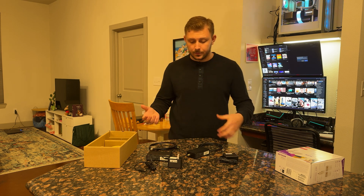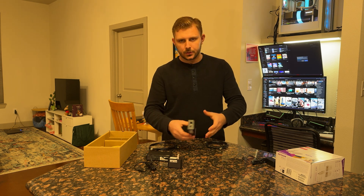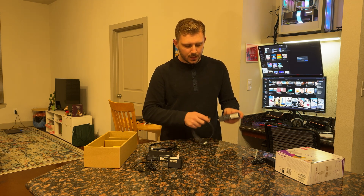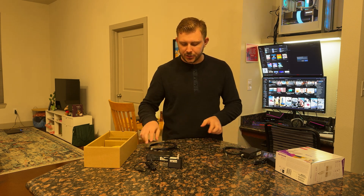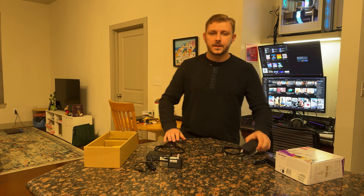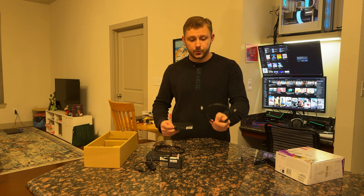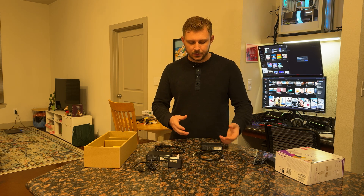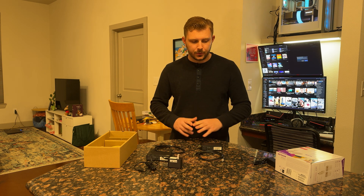To set these up: plug them into power, hook your ethernet up to your router, switch, modem, or whatever, hook your coax up here, put the other end to the wall where your coax jack is, do the same on the other end — boom, wired connection. The benefit of MoCA is that it's faster and better able to withstand interference, so you can transmit more data over it, and it's generally a little more reliable than power line. Both of these do introduce a little bit of latency, but it's really not much.